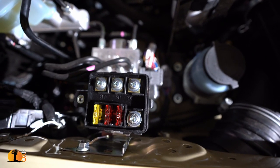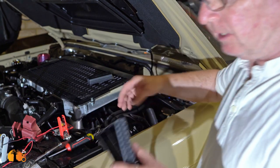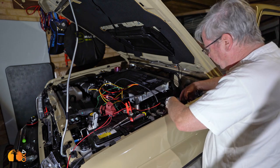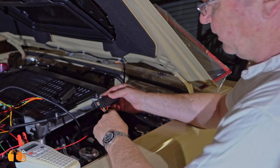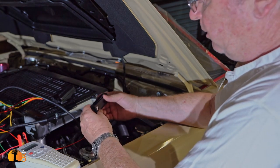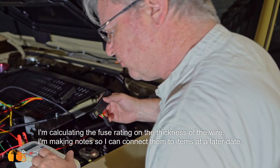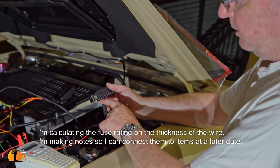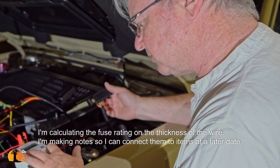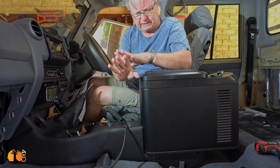There are actually two of these fuse boxes — one on each side. So the vehicle comes standard with all of this wired up. It is absolutely vital that you disconnect the battery completely when doing any wiring. One of the things I need to do is label each cable with my label maker. I've got four cables of different thicknesses and I'll put in the amperage fuse for each circuit now and label them properly later once I know what's attached. I'm making the first one 15 amps, the second a thicker one 20 amps, the third a thin one 8 amps, and the fourth one 10 amps.